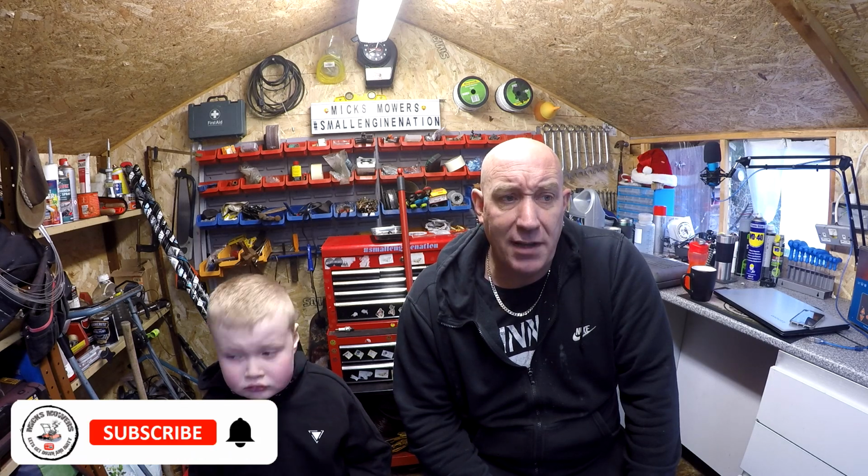Come on down. We're going to go and do the Masport today. Full service on that, and needs to have a new pull cord because the pull cord is very short, I think. So we're going to be doing spark plug, blade sharpen and balance, oil change, pull cord, done the air filter already, just a general tidy up. I want to give it a quick run to get the oil out of it.